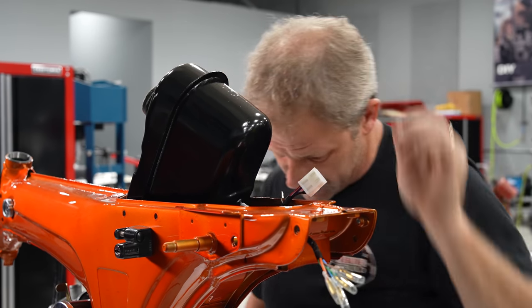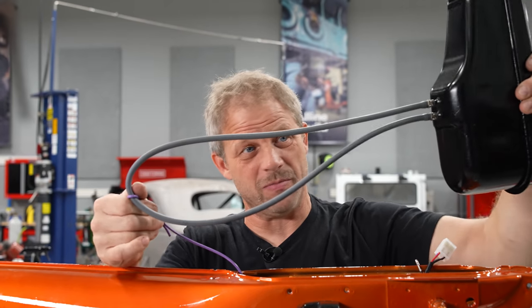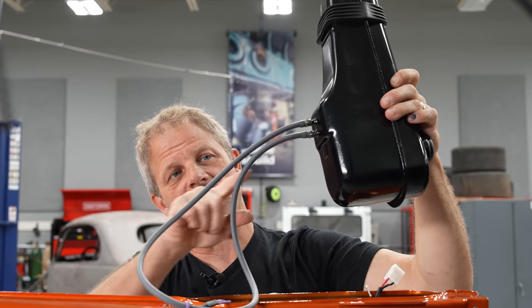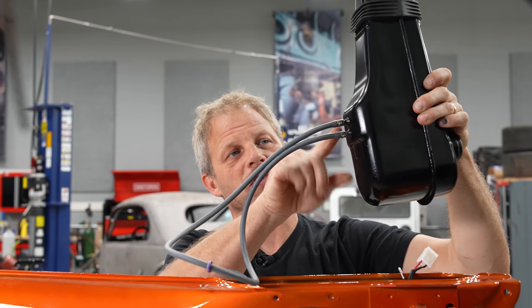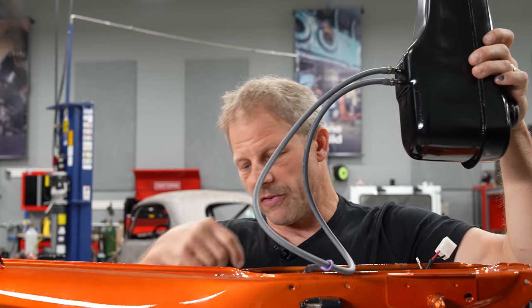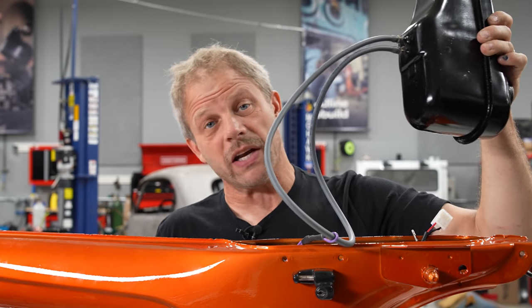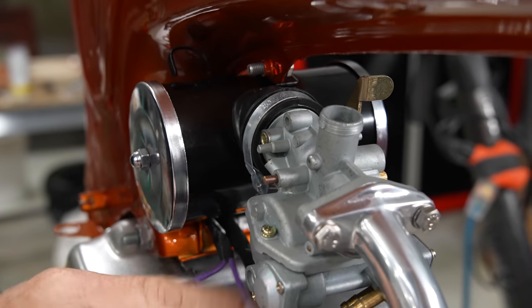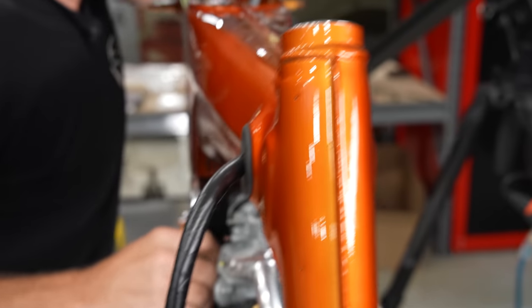I might have to pause that for just a second. If you're wondering why I have a wire attached to my fuel line that doesn't seemingly be terminated relative to the carburetor yet or cut, my thought process is I have a finite amount of tubing and I do need to use a little bit more for a couple drains. So I'm going to put both of them on here first. I can't put them on after it's in. Gonna thread this through, but I can't grab a hold of anything because I already put my air cleaner on, so my hole's kind of plugged up. So instead of taking the air cleaner back out, I'm just going to use this wire as a fish and drag it down, and then I can cut my fuel lines to size and minimize my waste.